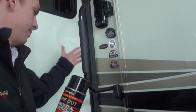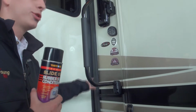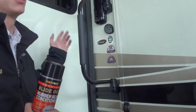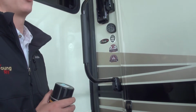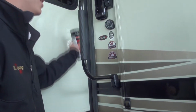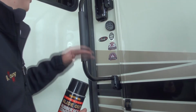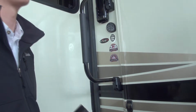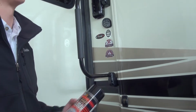Here it is. Basically, this is just a foam spray for it, and all it does is it prevents cracking in cold temperatures for the rubber. It keeps it soft, running nice and smooth. It's just basically a gasket seal. Okay. So like I said, foam spray twice a year. You don't have to go crazy with it. Each extreme season, you may come out, you'll take your spray, you'll just layer it on. You don't have to wipe it down. It just disintegrates. It seeps in. You may think about leaving the slide out when you've done that, just so you're not running the foam all over the windows and that sort of thing. Okay? So it dries. Yes, oh yeah, it seeps into the rubber and then just dries out.